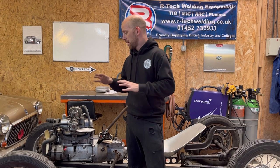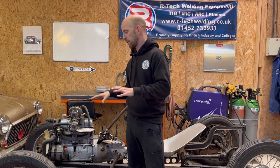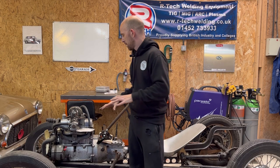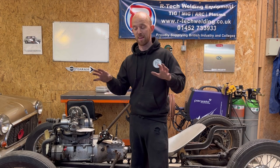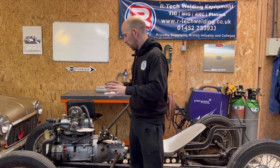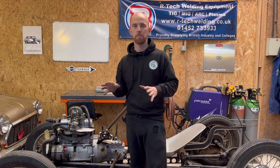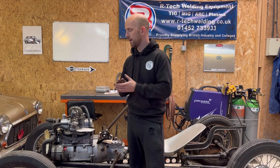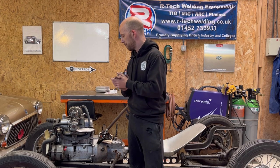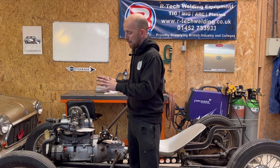So the aim for this video is to get the front spring changed, get the car to the right height, and get the engine mocked up with some temporary engine mounts. I say temporary because I want to finalise the design on them, but first I just want to mock it roughly in place to see where it's finally going to sit before I actually commit to them. And that is basically this episode.